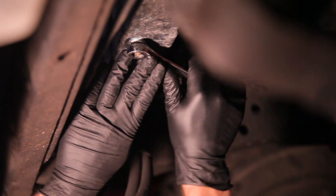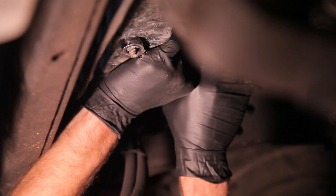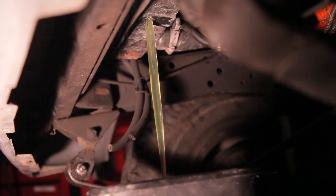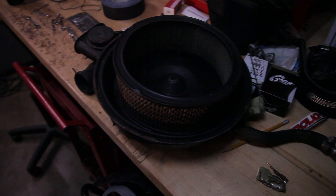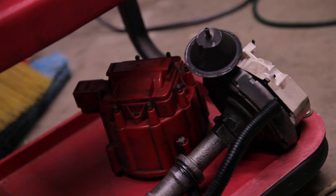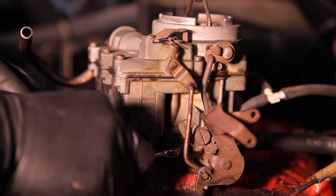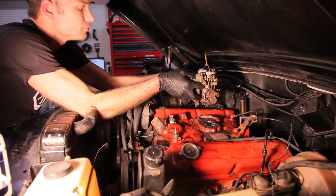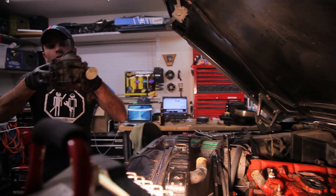The first thing you need to do is drain out all the coolant from the bottom of the radiator and make sure it's all the way drained. After you drain the coolant, the next thing is to take all the stuff off the top of the engine — distributor, vacuum lines, carburetor, a couple of coolant hoses, and anything else that might be in the way.